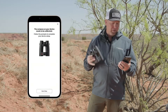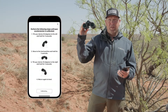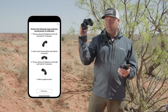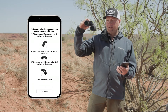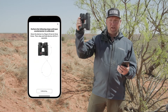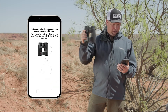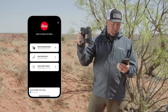Just hit OK to calibrate. Hold the binoculars at a 45-degree angle for three seconds, then back to flat, then the other 45-degree angle for three seconds. Now it's prompting me back to flat, then up, and then do two figure eights. You can see on the app that it says 'calibrating,' and then when it's done you hold for three seconds — and now it's calibrated.